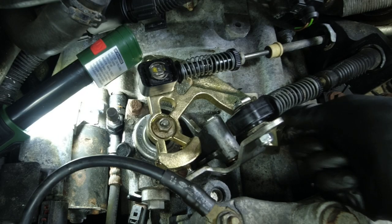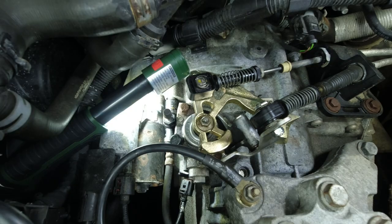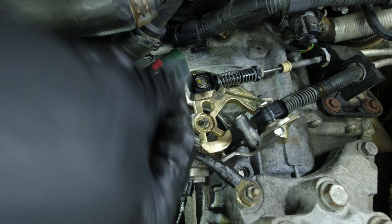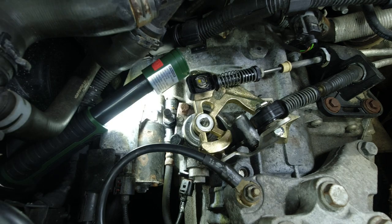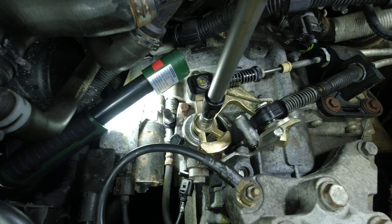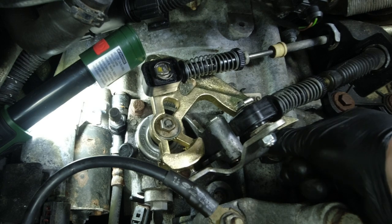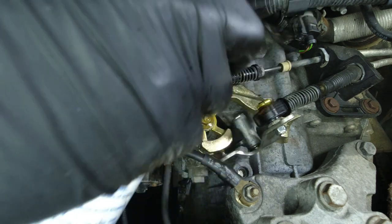As you can see there's a lot of up and down movement in this lever and this is why we can't just leave it as it is — it's going to have problems when you're changing gear. So remove this nut and pop on a washer, maximum 20mm diameter, on top and then screw the nut back down. Just make sure when you tighten it up that you don't over-tighten and risk snapping the bolt from the gearbox, because this is a serious issue if this happens. As you can see it has greatly reduced the rocking of that short shifter lever. Then spray some copper grease on the bolt and the retaining clips just in case you have to take them off again in future.